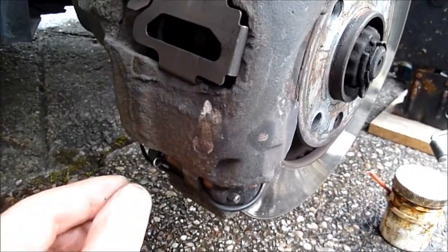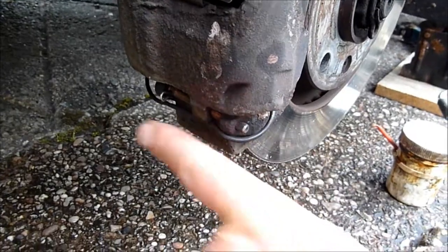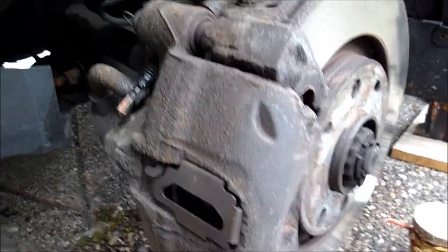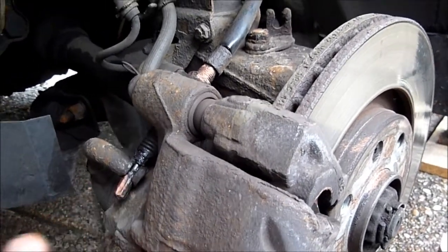When you get your brake pads out, all you do is pull that circlip out of there, get a centre punch, knock that pin out and this lifts up — it's as simple as that. But make sure you take your brake cable out first.